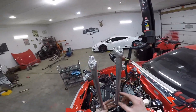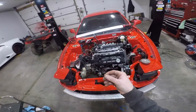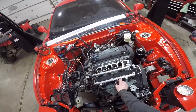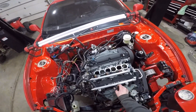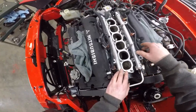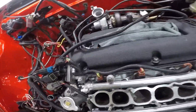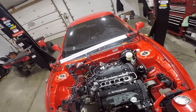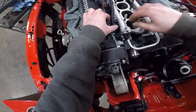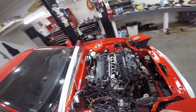These back ones I just left the wire on because this plugs in. These front ones I'm gonna have to clip back in — I actually think I gotta clip these in before I put it on. You have these clips that hold your injector plugs on. I know a lot of people don't even run them, but if you're on a bumpy road and they pop off you're gonna be sitting here wondering what's wrong with your car — why's your car running like shit when it's just one injector connector popped off, and that's not the first thing you're gonna go look for. The biggest thing is to get all those rubber o-rings lined up perfectly, because sometimes you'll get it to where everything's lined up and then one of them will be halfway out — and you know that's gonna leak. So just check, check, and keep checking. I torqued those fuel rails at 11 foot-pounds by the way — it's going into aluminum so I'm sure it's right.